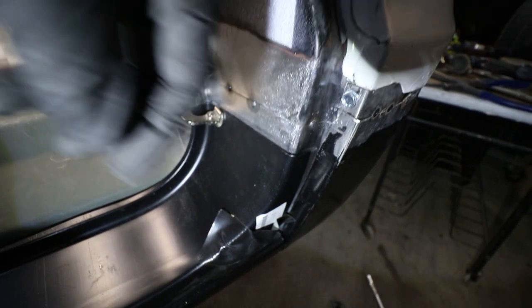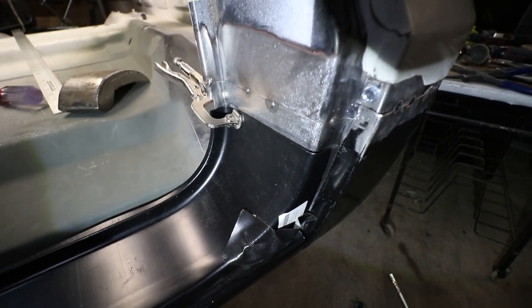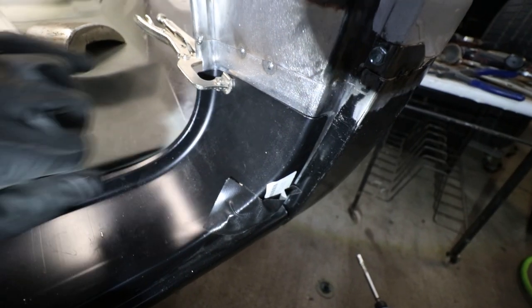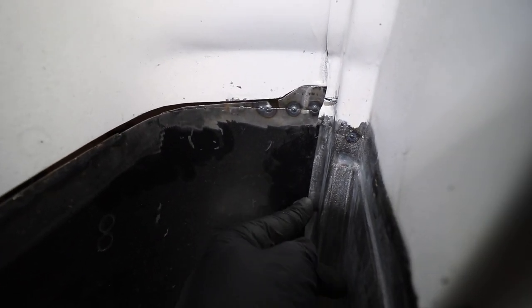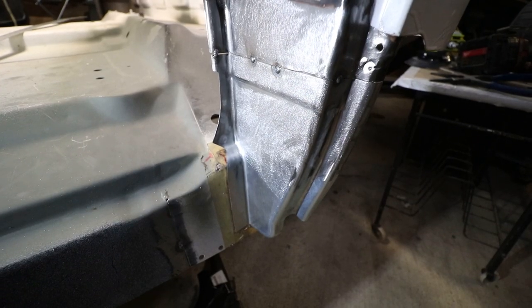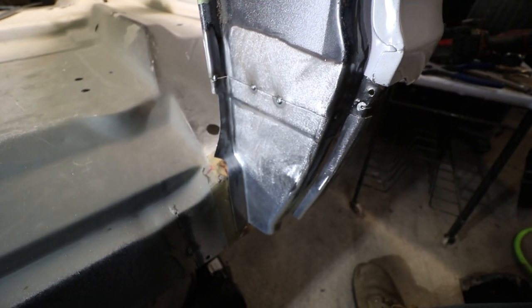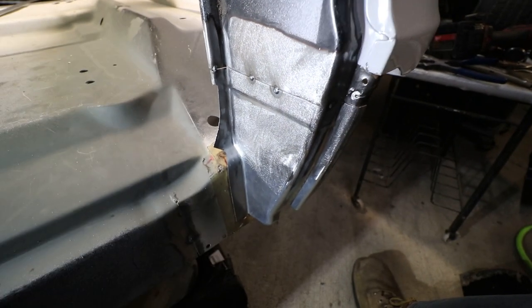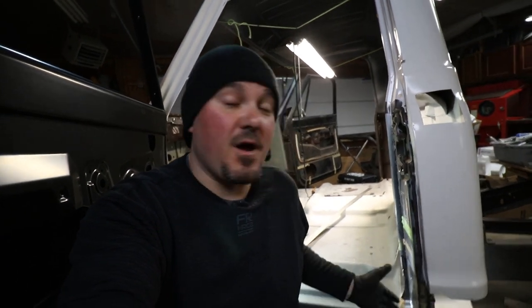This thing's tacked up in four different spots. It fits unbelievably amazing — I didn't have to do any modifications; I basically did this in two cuts. Everything lines up, and even the rocker panel fits pretty decent. You guys remember in the last video where I could actually stick my finger in between the B-pillar and the cab corner? Look at that — there it is without the rocker panel and cab corner, and man, this is awesome. So is this high-quality panel worth it? I would say for sure. This was two cuts and you're done — this thing fits like a glove. I wish I would have had this panel when I started this repair originally, but now I do, so I'm definitely buying one for the other side. If you guys want to know where to buy this panel or get more information on it, make sure you watch this video right here. That will get you caught up, and I will see you guys on the next one.